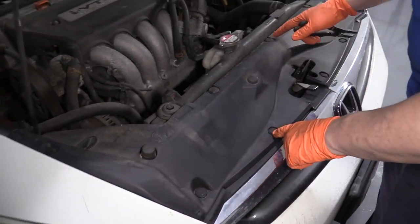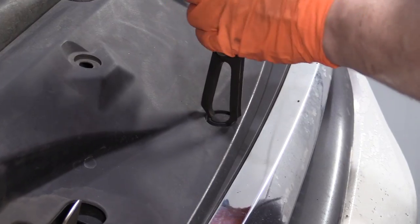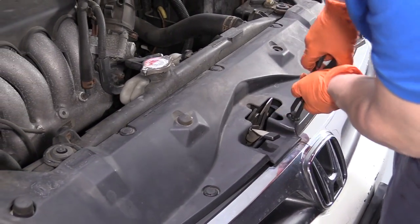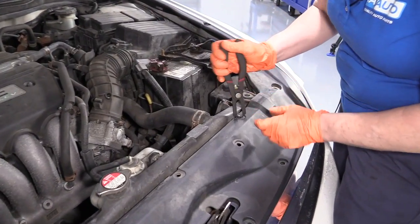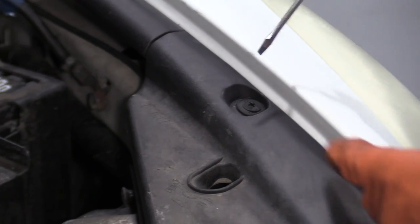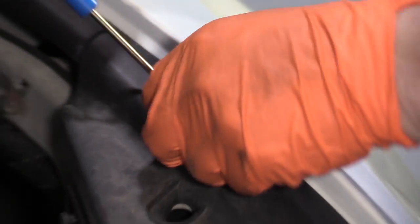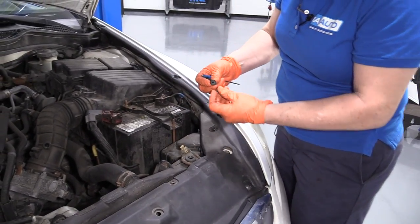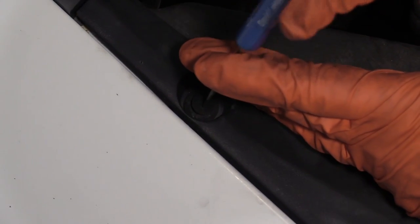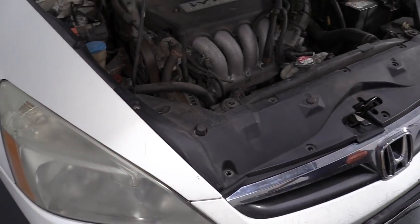We're going to release the body clips on the shroud area on the front of the nose of the engine. I have these little pliers that have pinchers on them — they go on each side and you can pull that body clip right out. I'm going to remove all of them. Now we have two Phillips plastic body style clips; just use a small pocket screwdriver and turn it slowly. The threads on these, because they're plastic on plastic, there's no real method to it. Now we can grab our cover and lift it up.